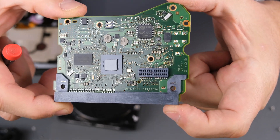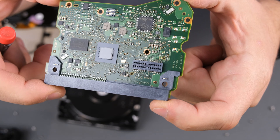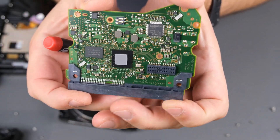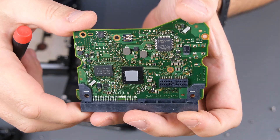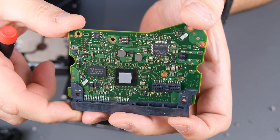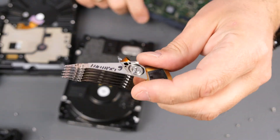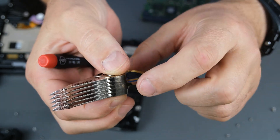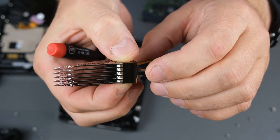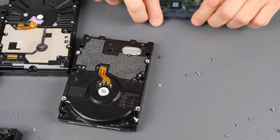They have two sensors that can be used for impact, acceleration, and vibration. When the hard drive is working, it's shaking in multiple directions — side to side, up and down, and rotation movement. That is why they are installed on two opposite sides. It registers movement, rotation, and vibration, and uses the CPU to send compensation to the heads, enabling better position and reaction to any vibration.